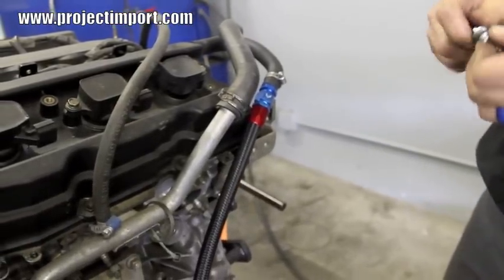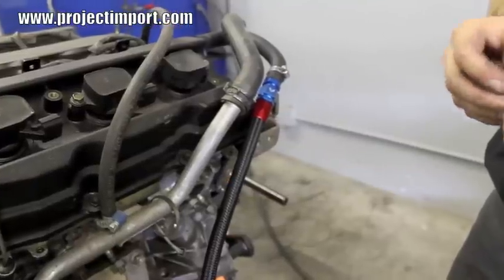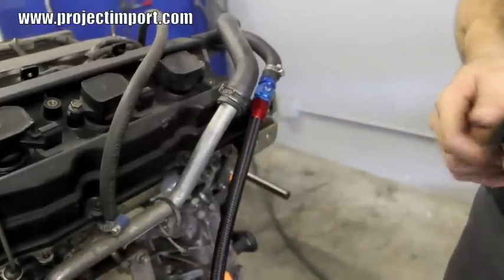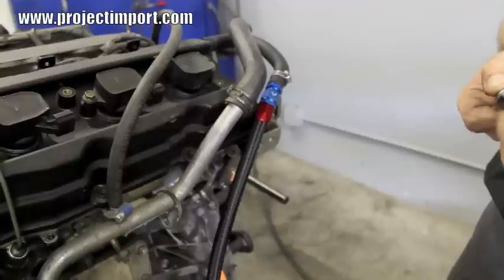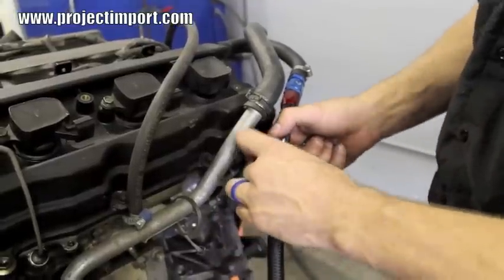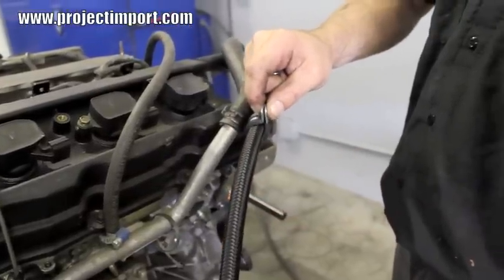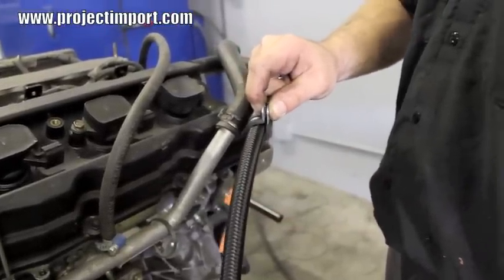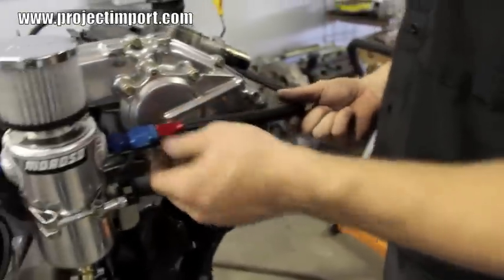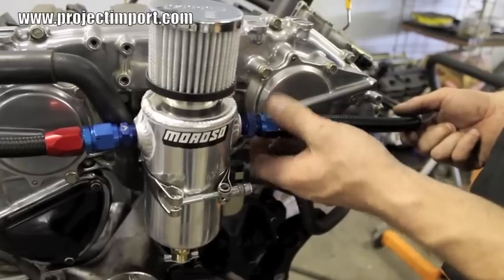On the body of your car, you'll note that there is a frame rail or the back firewall. We want to add a mounting bracket to help secure and hold this hose up. Due to the length of this hose, it wants to drape down — we don't want it draped down near the headers of the car. So we came up with a simple way to add a mount on the body of the car: take your bracket, put it around the hose, and find a nice orientation on the firewall to drill a hole and bolt it to the firewall. It will hold this crankcase hose up so it doesn't get anywhere near your headers. Again, a light amount of anti-seize on the threads and on the face of the AN fitting will help get this on and help with any disassembly down the road.